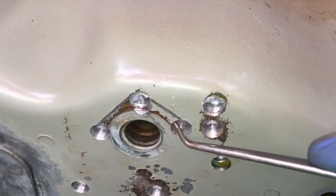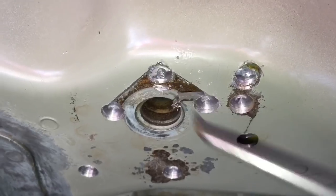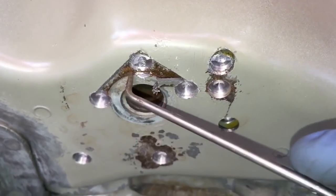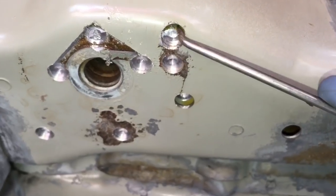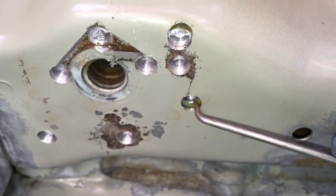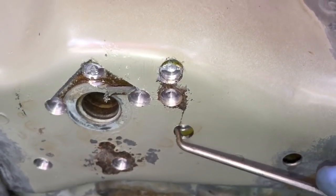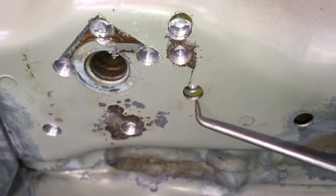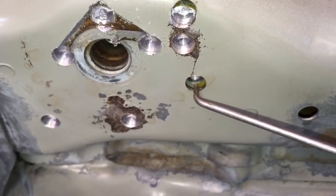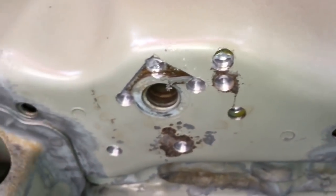The theory is we're just taking a section out there to allow our weld to penetrate into the threaded receiver — which is the platform we want to get to — to stabilize it, take care of the crack, and get rid of it. Another little crack was around that spot weld there — one crack going out towards the back of the car and one going towards the front. I've double oversized them because I know there's a platform behind. Rather than relying on just a 2mm drill, I'm using an 8mm spot weld drill because there's a hollow platform with about a 4mm gap in there. We like to oversize that so we can start a penetration on the threaded platform and then puddle it down, filling the gap so there's less chance of the panel bending up under load and unload over the years to come.